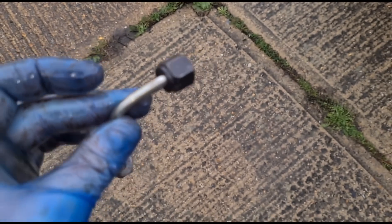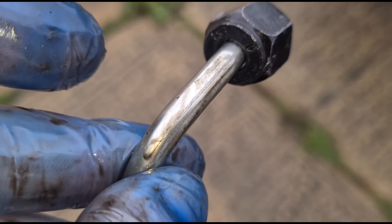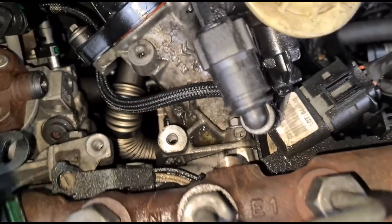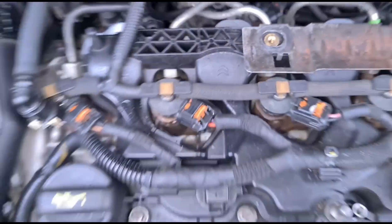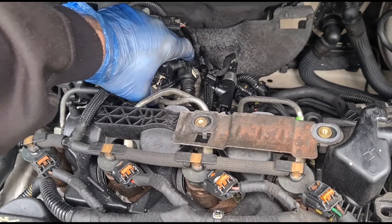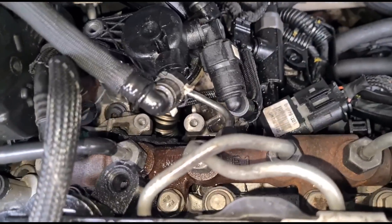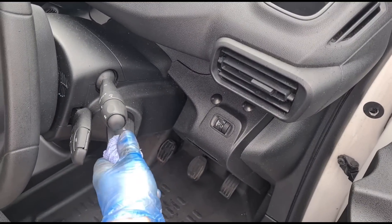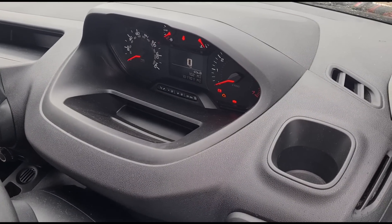Just trying to get the camera to focus — just there, it looks like there's some sort of marking right there. That's where the fluid looked like it was coming from. I've got the replacement and when I get this fitted, hopefully I haven't got this wrong. It looks to me like it was coming from the pipe. Okay, so just temporarily I'm gonna connect this back up before mounting that metal section back in — just want to see how it's sealed or if we've got bigger issues. Back at the van, using a bit of rag so I don't get diesel on the key. This should start straight up because I haven't lost any fuel.